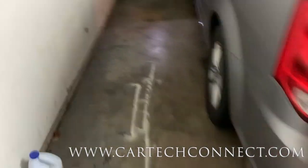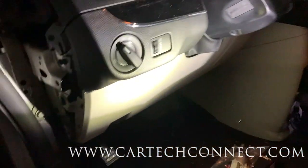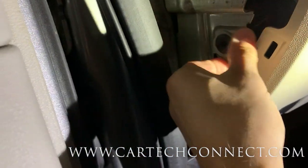Let's pull the door strip back and pull this panel out - one-handed's not gonna work, two hands. There we go. Panel pops out; put that someplace nice and safe. Got my flashlight - this is more true to life than being all prepared at a shop. There's one plastic rivet popper right there. There's a flat space you can get the screwdriver into and pop it out; usually comes apart together.